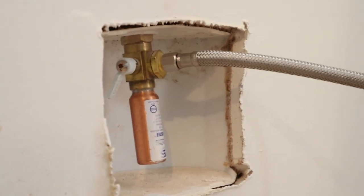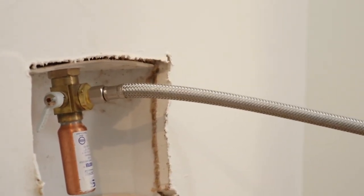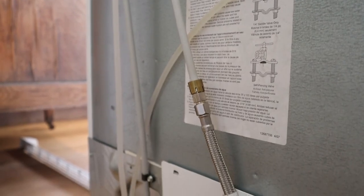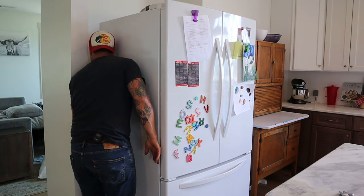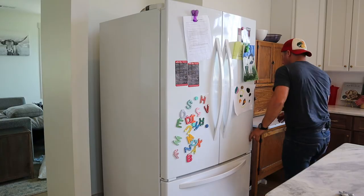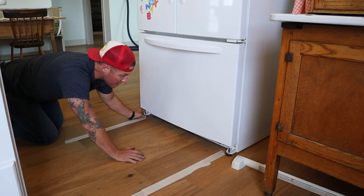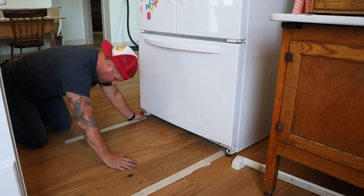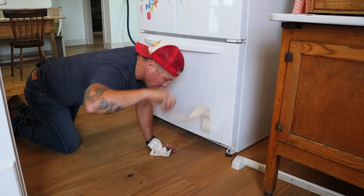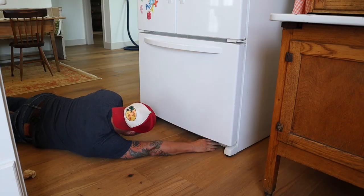This is your wall side coming out — it will look similar to this with a quarter-inch compression fitting male thread coming out of the wall, going into the female quarter-inch compression fitting on the stainless steel line. In the back of the refrigerator, the plastic line you see is from the refrigerator stock, and the metal line going down is the other end of our water line. You really have to watch the line as you're placing the refrigerator back — you do not want to kink it or get it caught up in any way. Everything went back great. I'll adjust my levelers and foot pads on the refrigerator, put them back exactly the way they were, remove the tape from the floor, and put the refrigerator front skirt back on.